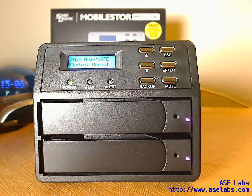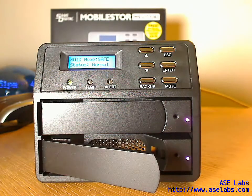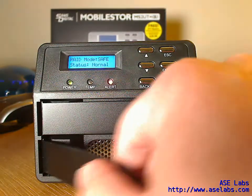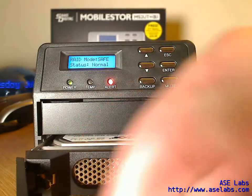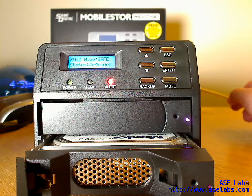Now, as you can see, there's a lot of data being transferred due to the amount of activity on the drives. Now what we're actually going to do is take this key again, stick it in this bottom drive caddy right here, and remove the entire caddy like this. Now you can see that the unit is in alert — hard drive number 2 is gone, status is degraded. And if I look, it's still copying fine. So it does handle failures very gracefully.